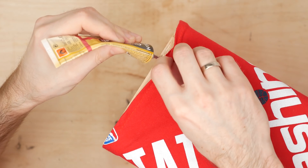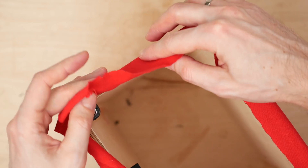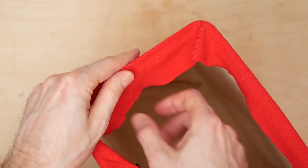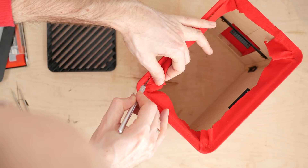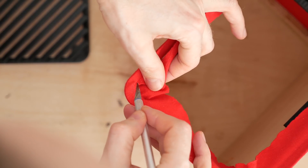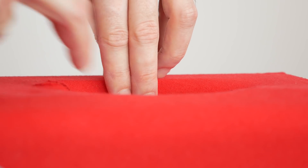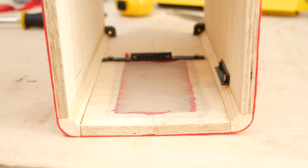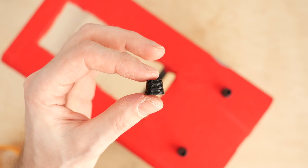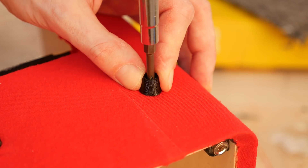First I glued the back, then the front, making sure the material was evenly stretched. The corners were a bit tricky but I took my time and managed to get decent results. When the glue dried I cut off the excess fabric. I also made an opening on the bottom for the GPU air vent and glued the fabric to the plywood, then filled the void with some filtering material. To allow some air in I printed a set of 1cm high feet, and applied glue onto the fabric to make it solid so the screw doesn't catch the thread when screwing down the standoffs.